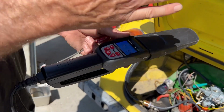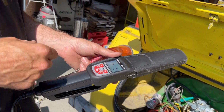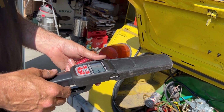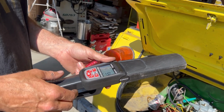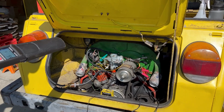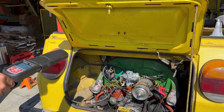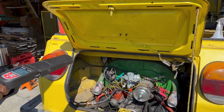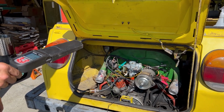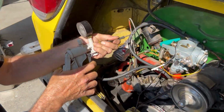So as the points wear, that's around the wear limit. So what's ideal? The ideal is like 44. Oh, okay. So a 10-degree range, basically. If you think about what it's doing, that makes some sense. It's not super critical. It's actually a pretty tight mover if you consider 360. That's probably a couple thousandths of adjustment. And you'll see when we adjust the points, it's not science. Alright, well I'll get those feeler gauges.